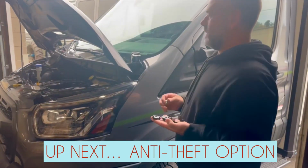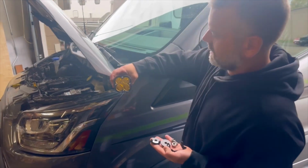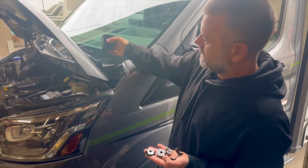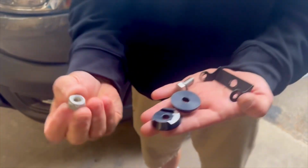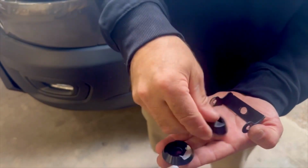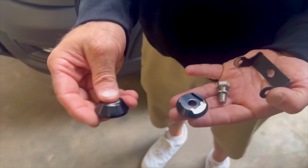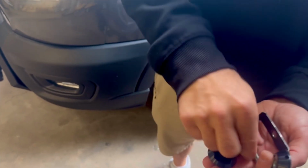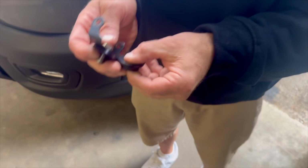So one of the things that I was pointing out in the video earlier is a particular way that you can install, in this case, a Baja Squadron pillar light to your new Transit Off-Road hood light bracket. However, if you go to the hardware store and you pick up a little bit larger nut that fits into the billet, remember the billet is supplied with the bracket, and in most cases, you're going to take this just like that, and you're going to marry the two through here.